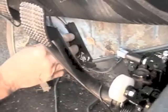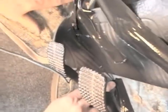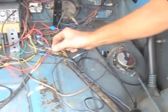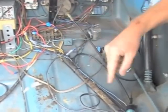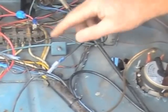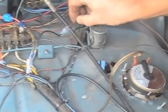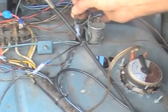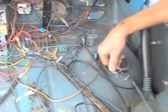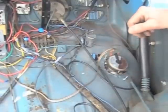We've got our harness connected here to the switch and we duct-taped it to this area here. We also put some tape around it here so the harness is going to stay in place. So let's move into the trunk and we can hook up the wires and get the taillights to work now. This is your brake wire here coming out of this terminal. This is the brake line going to the back — power's coming here, and once the switch is activated it's going to go to this wire back to your brake lights in the back. I'll show you how we set the switch from the inside and then proceed to the next procedure.